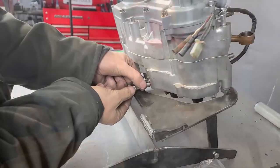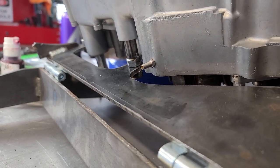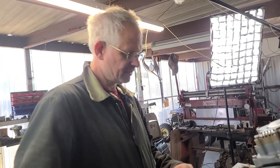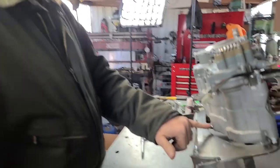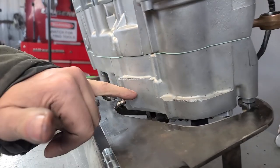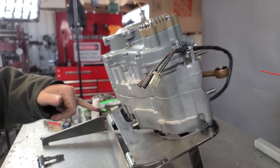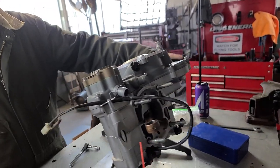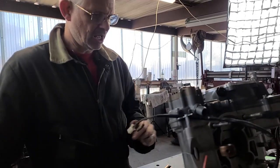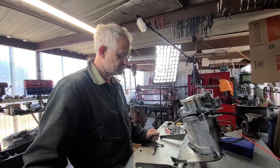All right, now we're going to swap it around and put the stator assembly on it. You'll see these things come apart all the time — they're sweating on the inside and starting to rust the stator. There are a couple of things you can do: you can put a tap down here and put a rubber hose on it to get it up high so water doesn't go in but somewhere for it to leak out, or you can run it up into a tap between the air filter and the carburetor where there's vacuum. I've been keeping a vacuum pulled on this for years because on the West Coast, especially in Oregon, they sweat inside there all the time. I just keep a vacuum pulled on this and then it's all good.